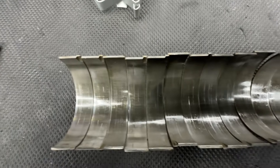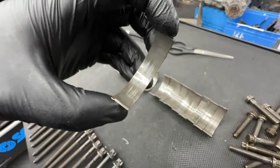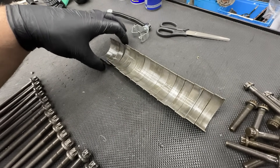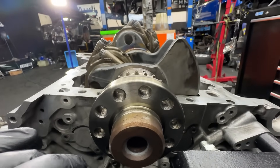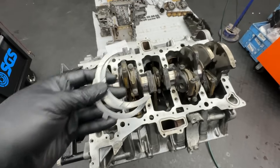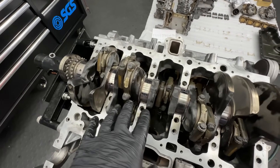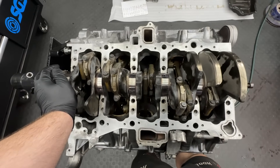From the previous video you probably remember - if you don't, these are the bearings, and all of them are literally 3, 2, 1 and they are gone - this will seize up very soon. This is the answer to everyone asking me about used cars - every used car is very individual, and I can't tell until we strip it down. I can't forget to put the thrust bearings in - we have new ones as always. We also have to degrease the whole block. Four gaskets need to be put in there, and once in place we have to tighten the conrod bolts to 90 Nm, checking that the crankshaft is spinning after every session.